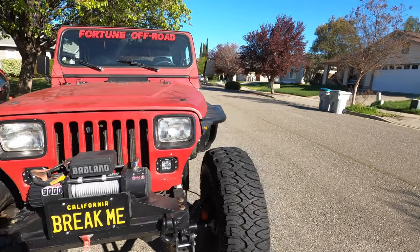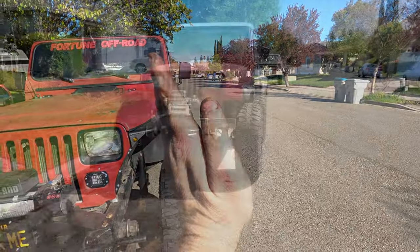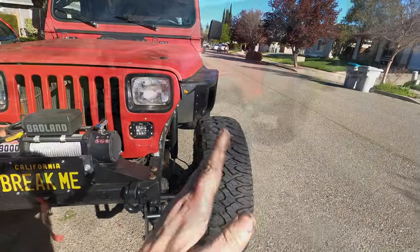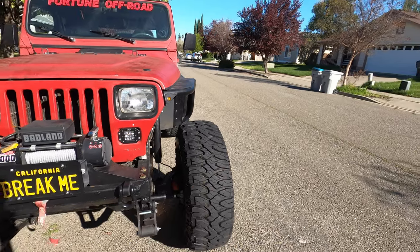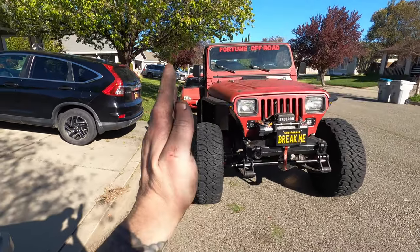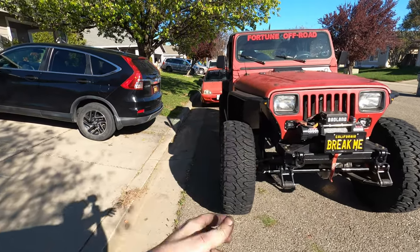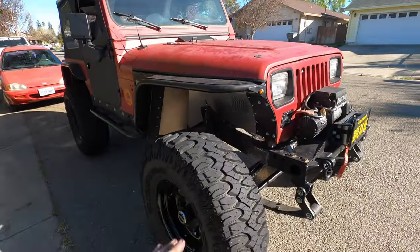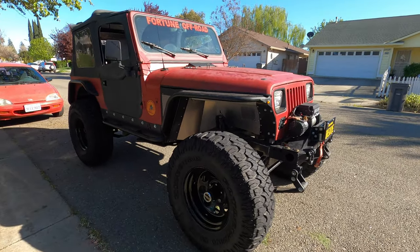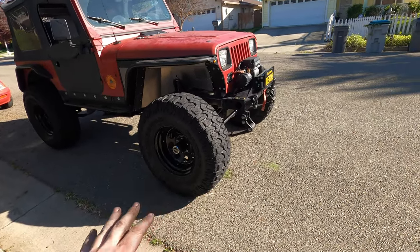A couple of videos ago I mentioned the camber on the front tires — both had positive camber, sticking out on both sides. The previous owner got ahold of me and said the shim in there was on upside down; if you flip it, it should even out. It did — this side is perfect. The other side looked perfect when we did it too, but it must be because of the new knuckle. This tire in the front is actually going negative — it's inside a little too much. So yes, we are going to have to tear that apart again, but thank God we don't have to take out the RCV axle shafts. Now that I've done this so many times in a short period, I'm actually pretty good at it.